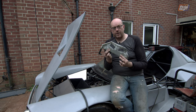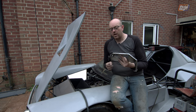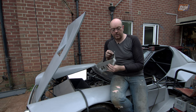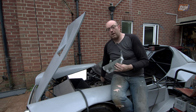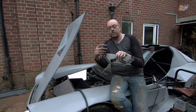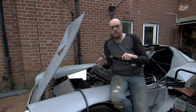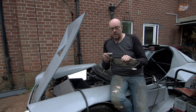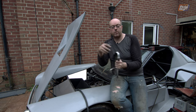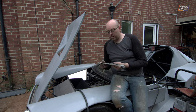About an hour later, we have a finished bracket — albeit it's not painted and there are a couple of slightly suspect welds inside, but the rest of it works nicely. This one bolts underneath here where the windscreen wiper goes, as planned. On the back I've added a little extension which drops right down onto the old mounting point from the windscreen wipers so we can just weld it on. I was just going to have a flat piece that came straight off, but I thought it might be a little bit flexible and might snap off, especially if it gets knocked. So I've made up this little double L-shaped piece which sits on the back and just screws in. We can weld along the bottom and along the top and really fasten it nicely onto the old mount under there.